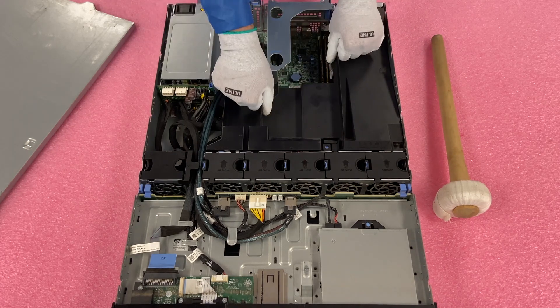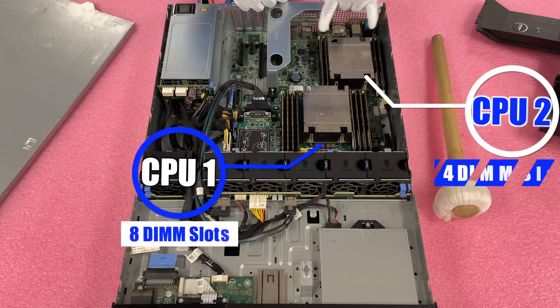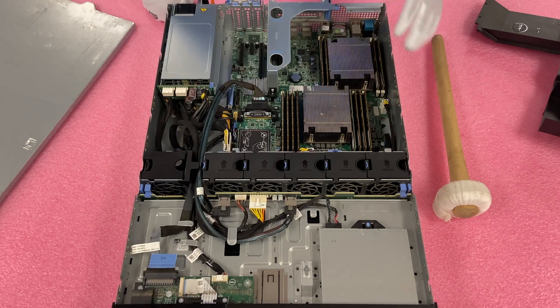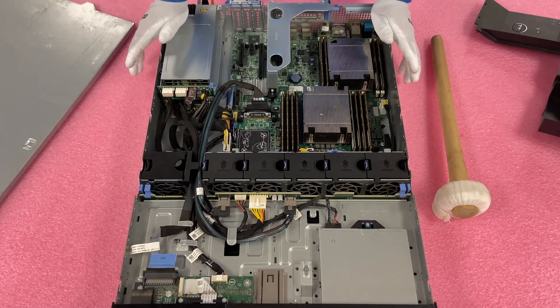If you lift up the air baffle and come inside, you'll see there are two CPUs. CPU 1 controls eight DIMM slots and CPU 2 controls four DIMM slots, giving you a total of 12 DIMM slots. Here's where your RAID cable goes — we're going to do a video on RAID and show you how to install them and the different options. You'll also notice a couple of differences compared to other systems: you actually have an iDRAC card back here as opposed to it being built into the motherboard, and you also have a built-in NIC card as opposed to installing a daughter card. This riser right here has the two full-height bracket slots. That's the general layout of the system and the different parts inside.